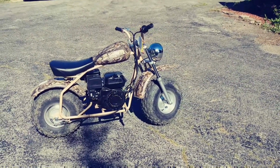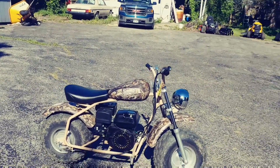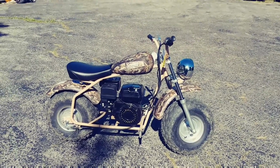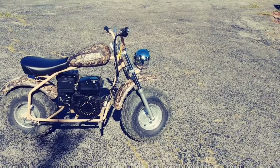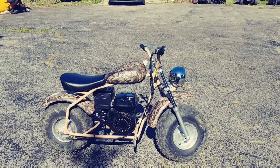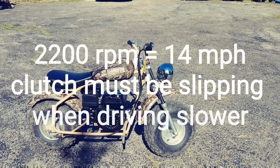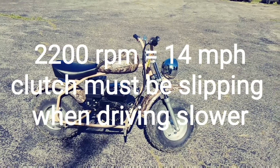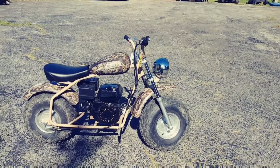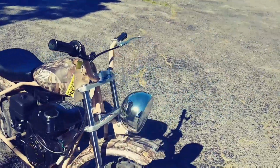I think there's some mathematics of the centrifugal clutch. See if you follow me. The engine runs around 3,600 RPM. The max speed, they say, is 24, maybe not with me on it. The clutch kicks in at 22. Basically, you can tell this clutch is slipping till you're over 12 or 15 miles per hour. And back, you know, literally off-road, I didn't want to go that fast. So I'm definitely going to want to gear this thing down.